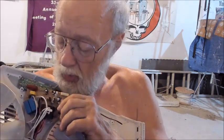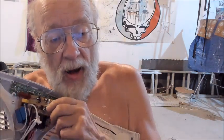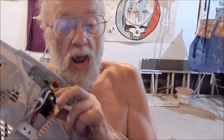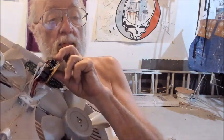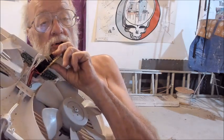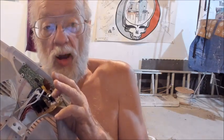There's one there and one there. And then there's a great big one right there. And that sits on the power circuit. And when I first looked at it, I said, that's the problem. Because what happens is these things go bad and the top starts bulging. You can't see it, but this one was bulging. That is, I suspect, 99%, that's my problem, a bad capacitor right here.